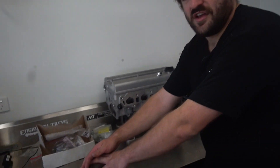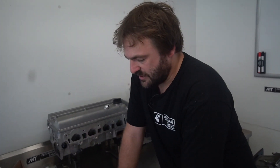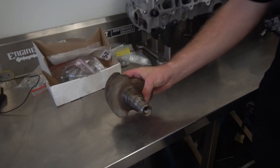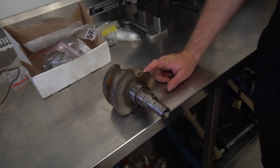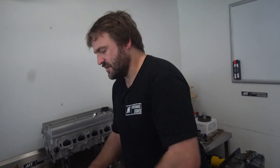I would measure how much material I've taken before my balance factor starts traveling too far away from what's acceptable. The easiest way to tell the balance factor of an engine — it doesn't particularly matter what type of crankshaft, a 42mm 4A crankshaft — I would be looking at a silvertop 20-valve small port 4A, a late model big port 4A, and looking at the piston and rod combination weight on that crankshaft. That would be a good starting point for a balance factor of 7,500 to 8,000 RPM. Anything more I want to increase the RPM by, I'd be looking to lighten up that piston and rod, but I definitely wouldn't be taking any weight off the crankshaft.